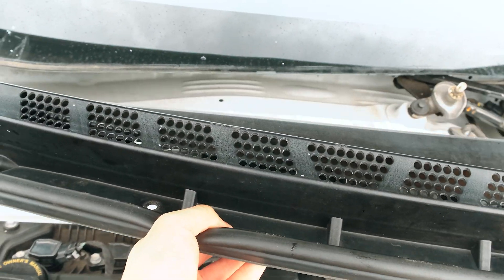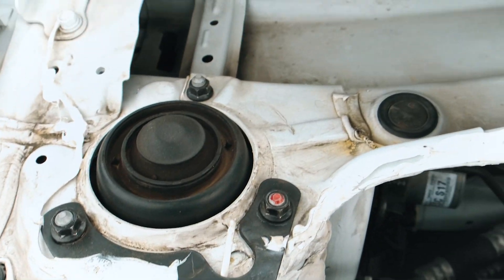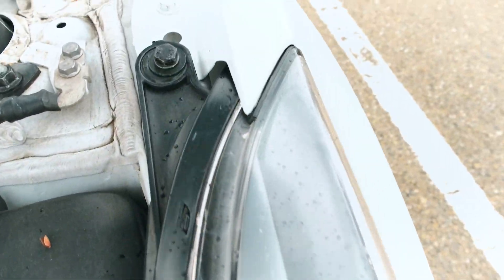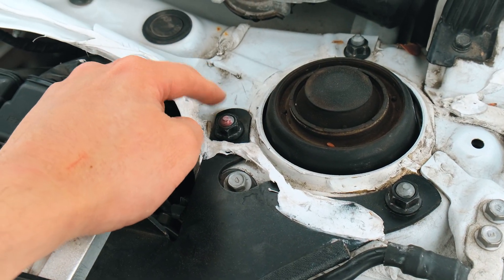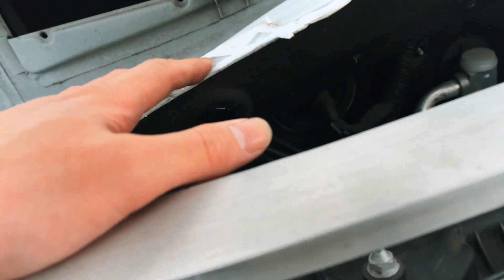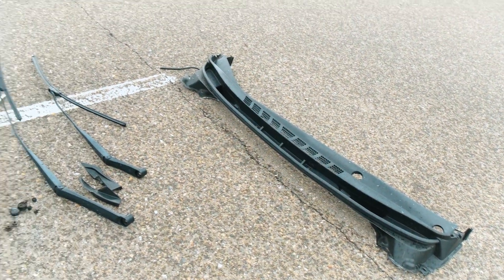As you know from the other videos, I am investing in a little Audio-Technica $40 lavalier mic so that we can have good audio whichever way the camera is facing. There's our strut mount, there's our cap — our mushroom top — three bolts. Essentially this is how you do the strut bar: you get those undone, attach it on here, and put the bolts over it. These want to be torqued to about 54 pounds. This white stuff here is a new seal I made for the passes from the engine to get through to the cabin air filtering system for ambient outside air.